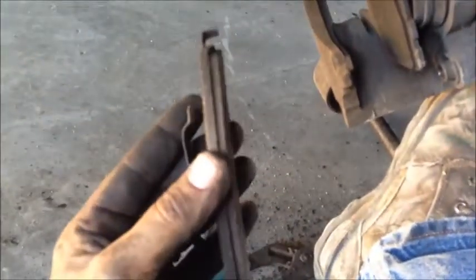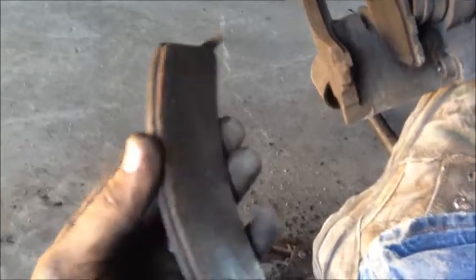Okay, so there we go. It snapped right out. So that brake pad came out. You can see that thing was definitely due to be changed too. It's down there a ways. Still good there, but okay, at this point you can see the cylinder is out almost an inch. This cylinder needs to be pushed back. We're going to leave this brake in there because now we're going to use our C-clamp.